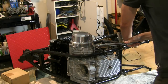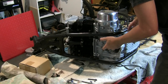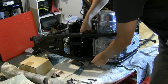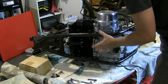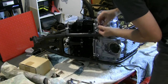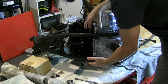One thing I'm learning in hindsight is that when I torqued down those two bolts I aligned the engine and frame to those points, and as I got to the front mount brackets things were too tight. The lesson there is leave things loose until you've got them all in, then start snugging them up. I went back and loosened that one, tilted the frame up a little bit, got it aligned, and now I can get the bolts in. We've got two bolts holding these brackets on each side and then one big bolt that goes down through the channel and holds it to the engine.